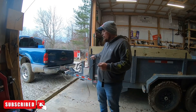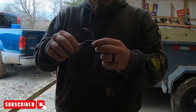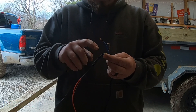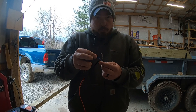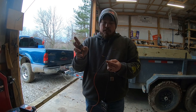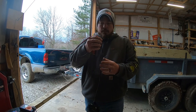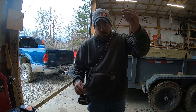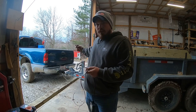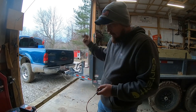It's got a plug — it does not plug into that; it probably plugs into the Badlands winch. So right here, what I've done on the test bench: black is usually ground, so I assumed that was ground, took my hot and touched it to blue — which is a lot of times key. I touched it to the blue, nothing happened. I touched it to the yellow, hit the button, and these two wires sent juice through it. Now I know what my hot and my ground were. I went ahead and soldered red and black — this will go to the battery. Now I just got to figure out in my box which part of the solenoid needs to go hot to let it up and let it down.